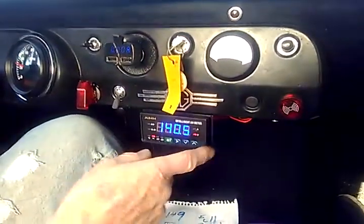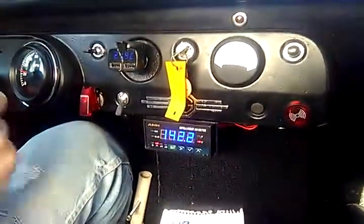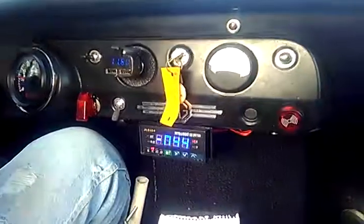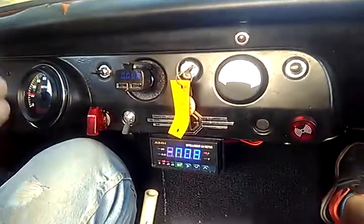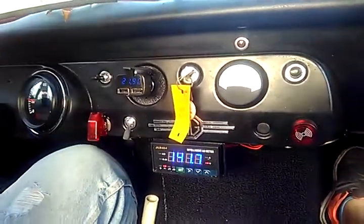The first question might be where do you want to leave this meter while driving. I kind of like to leave it on the amp setting so I have an idea of how my driving is going. But you also want to keep track of your voltage so it doesn't get too low, and you've got this meter here that you can look at.